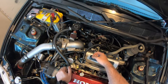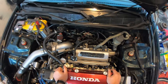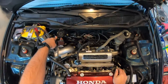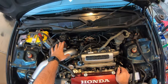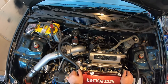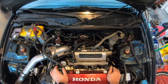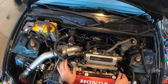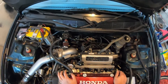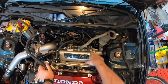What that actually gave me room to do was run this Mishimoto compact catch can. I also have the JB Tuned block fitting where you get rid of the factory black box oil collector, so that's running from here to the intake side. Then I'm running from the valve cover to the other intake and venting to atmosphere. I found that if you try to do this in a recirculating setup, the supercharger sucks in so much air that it fills the catch can really quick — like two to three miles of driving. Once I ventilated it, it's good to go.